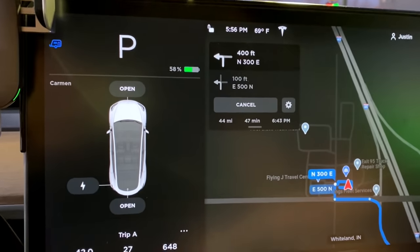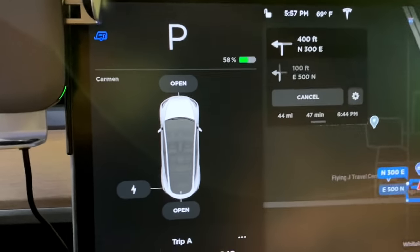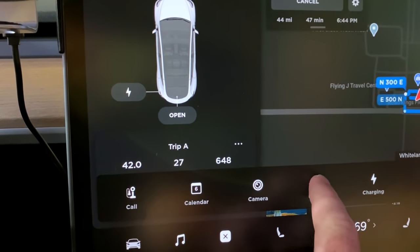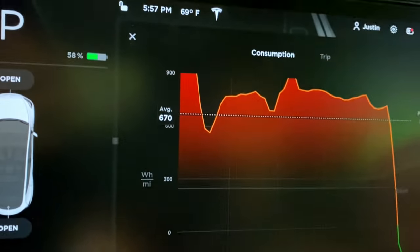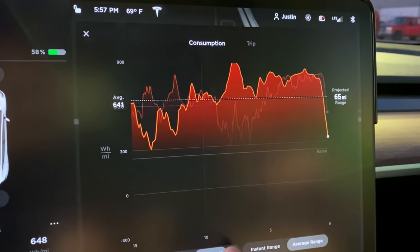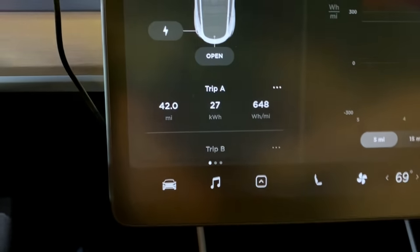We have 44 miles to go, we've traveled 42, and we are at 58%. I think we're still on track for about 100 miles of range, which is going to be close. We're at 648 watt-hour per mile, and as you can see this last stretch we were well up into the 700s. It's saying 62 miles of anticipated range. Pretty consistent — about 60 miles is what it thinks. And if you add 60 to 42, that's 102 miles. So we'll get back on the road and get to the campsite.